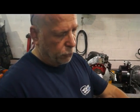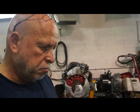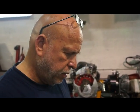Bosch EV14s. They come in 3 different heights, and it's what FuelTech sells for their fuel rail kit, which is what we're going to use. Direct drop-in, and the resolution is fantastic. On a ported engine, you could actually idle the motor smoothly on a 2000cc injector, a big port motor, like a Bridgeport or something like that.